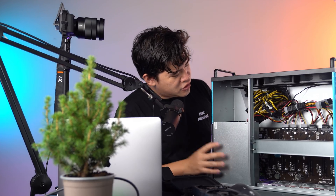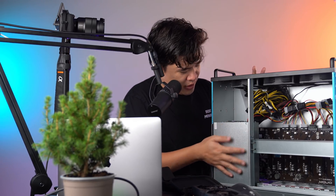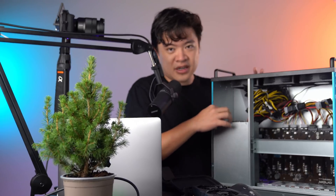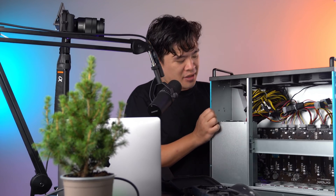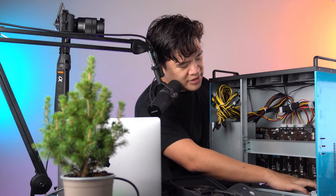First let's take a look at what's inside. I just opened the machine up. It doesn't seem to be too complicated inside. So this is what comes out of the machine straight away. Inside you have the power supply — it doesn't really say brand on here. This is kind of the heart of the power side of the unit. It has a lot of connectors. Everything is connected on the computer side, so all you really have to do is plug and play the graphics cards inside. The motherboard is already set up — it's the D1000 BTC. It should be ETH, right? I'm sure the marketing department had a little snafu there — you can't really mine BTC on graphics cards.